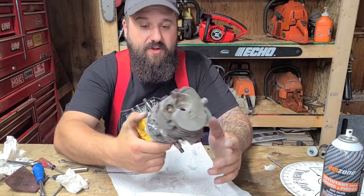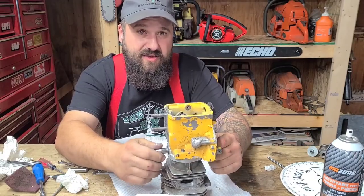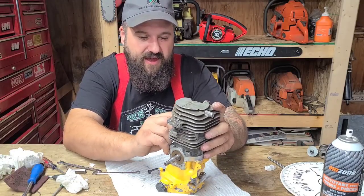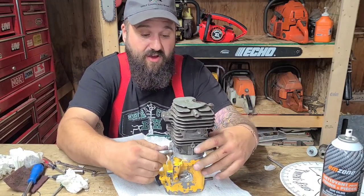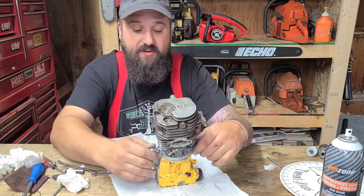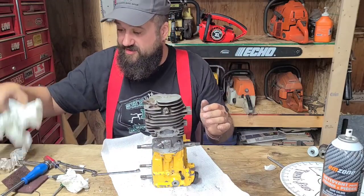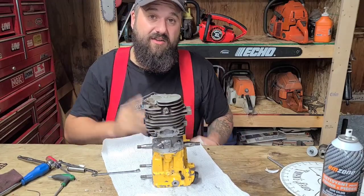There is a McCulloch engine assembly. The porting we did: 99 degrees on the exhaust, we have 15 degrees of blowdown, and the intake opens at 131 degrees right now. We're going to try it like this. I have other little go-fast moves I'm going to do as I go along — we're building this in stages. If it's good I'll send it to Buck; if not, I'm going to pick this saw apart. Listen to that — these things change directions violently. If you guys have any questions, email me at tinmansaws@gmail.com. Thanks for watching, take it easy — I'll see you guys in a couple days.